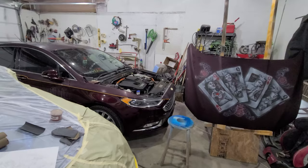We're going to do one heavy coat of flake. And then we're going to do a couple coats of just nice clear and even all that out so that we can buff it out and get the flake nice and smooth. So anyway, let's start off by masking it up, reattaching the hood, and then we could almost call it a wrap. And we'll be done with today's episode. We can move on to tomorrow's episode.